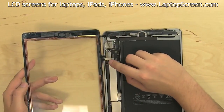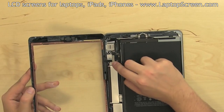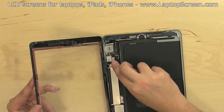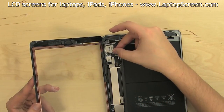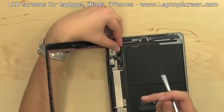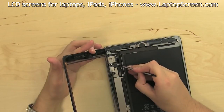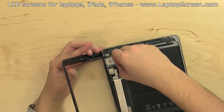At this point, the new parts can be installed. Align the digitizer connectors with the logic board and plug in the two silver cap connectors — they will make a distinctive click when plugged in properly. Slide in the home button flex cable, ensuring that the cable is in all the way and that the white stripe is parallel with the connector. You may need to use a screwdriver to help insert the cable. Close the securing tab on the connector and replace the black tape.